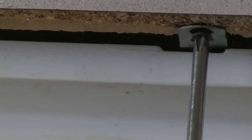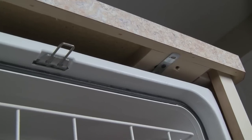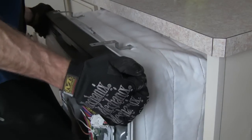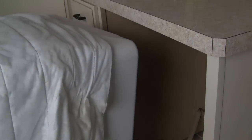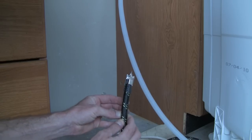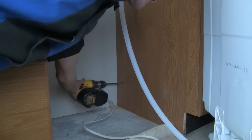The dishwasher should be anchored to the top of the cabinet with a few screws. There may also be a few screws passing through the sides of the dishwasher, but this is rare. Once any mounting screws have been removed, tip the dishwasher forward and lift it out. Now you're clear to replace the lines, clean up, make repairs — whatever you need to do. You may also need to expand the plumbing holes for new larger lines.